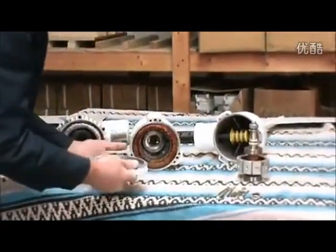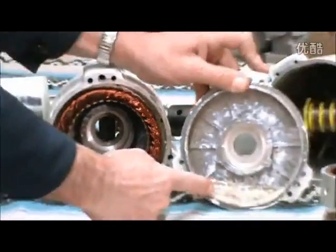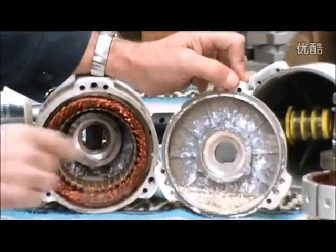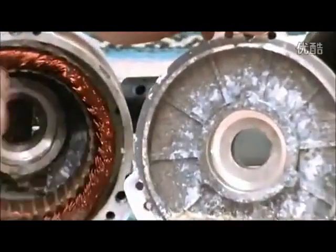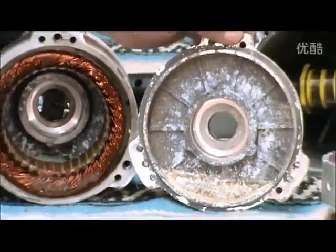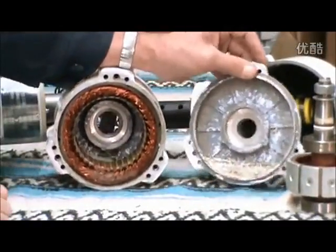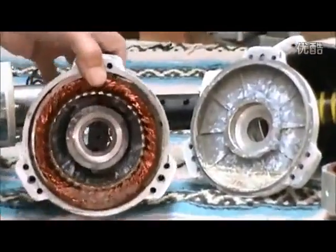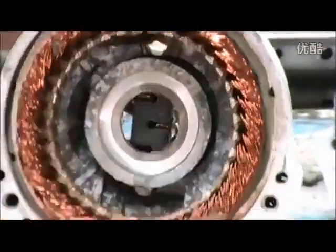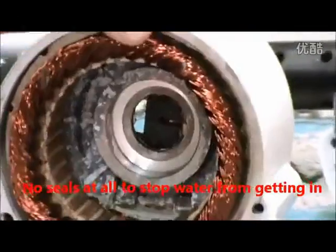This is the cover — this is what happened. This is the cover for the Gudcraft. Do you see this line right here? When I pulled this apart, it was half full of water, that deep. This thing was filling with water, and you can see the corrosion. Now if you look into the stator core, you'll see that it's all corroded in the front and in the back. Water was actually literally building up inside of this, and it was getting ready to short it out.